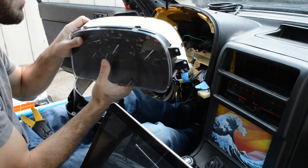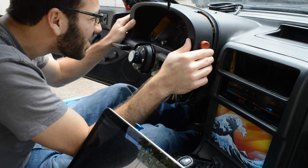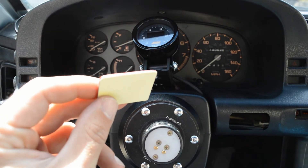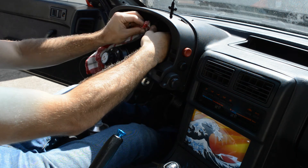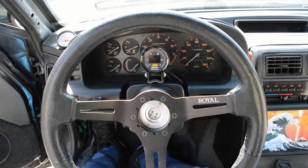The last piece of the puzzle is installing the gauge into its holder. You'll need to buy a gauge mount depending on where you want to mount it — I got a universal one, link in the description below. To mount it I used a really simple method: GoPro-style double-sided 3M tape to attach it onto the dash. Previously I tried drilling screws directly into the old brittle plastic dash, but the sun eventually caused it to crack. I've learned not to drill through this old plastic again — the 3M double-sided tape works great and hasn't moved in the two months I've been driving with it.